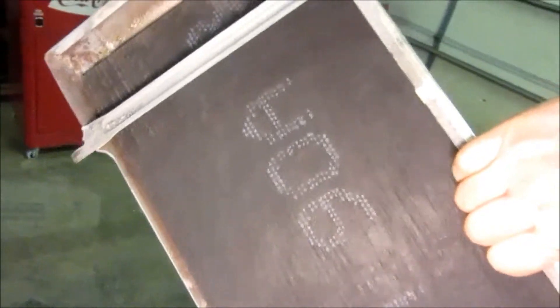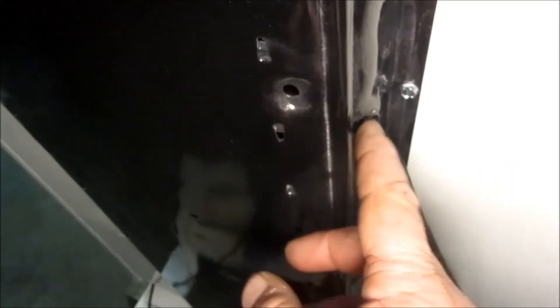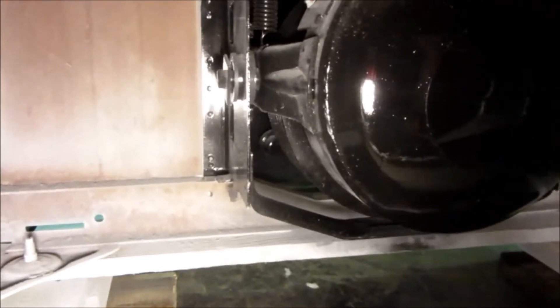Even the area that's going to be hidden down there is painted nicely. The kick plate is painted, got the trim back on it, got some acoustic fireproof insulation on the inside. Won't be long — this one will be ready for a test run. Got the back cover back on, of course, put new screws in there to make it look nicer, new screws holding the cooling system in. See down in there — things tucked away nicely, cord goes through a little original brass grommet right there. If we look in from the front, you can see the nice round Westinghouse compressor in there, all painted black. Putting the nameplate back, getting the brackets in place, going to get that front kick plate in there.